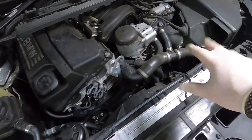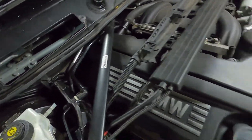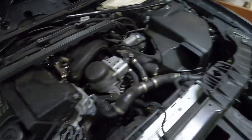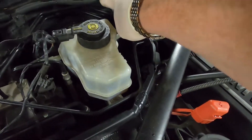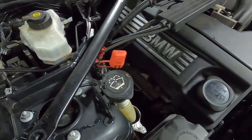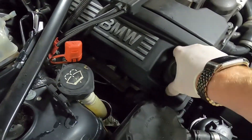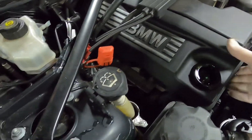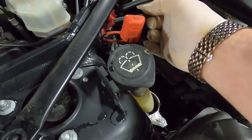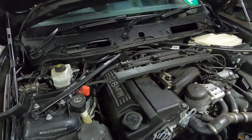We've made some progress. Air inlet is off, then there are lots of little 8 millimeter bolts on the air inlets and on the air filter cover. When putting that back on, it's very important to get it clipped correctly onto the rubber seal to keep water out of the engine. We're taking off this bar with an E12 socket on this end and the same in the center. We also remove these power cables - two screws - to lift them out of the way.